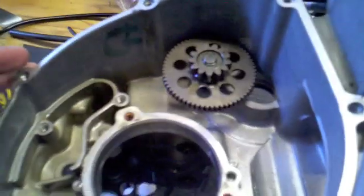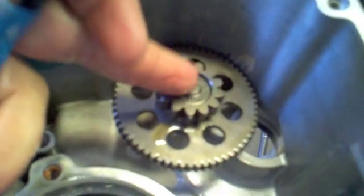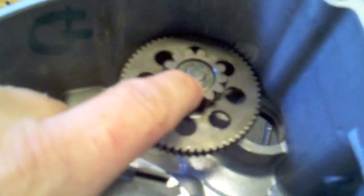About the last piece I have to remove on this assembly is this little gear. There's a bolt on the outside of the crankcase you remove, and then there's just this little circlip right in here that you've got to remove to be able to pull this thing out. There we go — circlip removed, flew somewhere, and then this pops right off. And that's it.